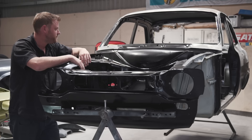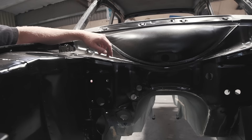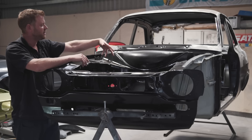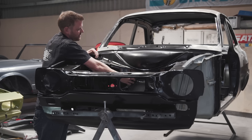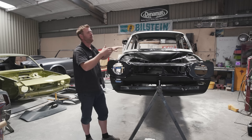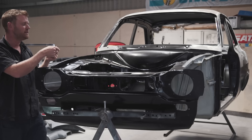On this side are the engine management wiring holes. We're going to build a loom ourselves with bulkhead connectors so the ECU and the inside-of-car part of the engine loom is separate from the loom on the engine itself. There'll be Deutsch Autosport connectors actually bolted to the bulkhead here and here, so you can unplug two plugs and completely separate the engine loom from the car. We've done this for all bulkhead connections — no pipes or wiring pass through rubber grommets; it's all connectors onto the bulkhead.